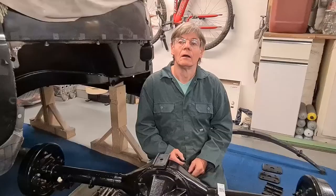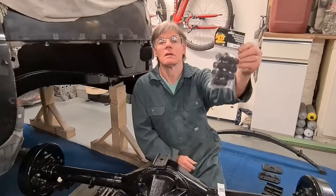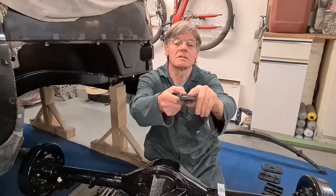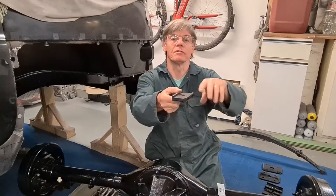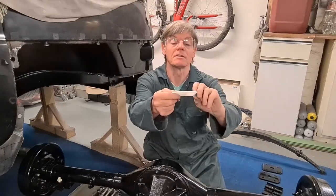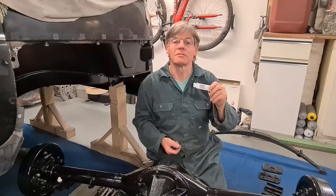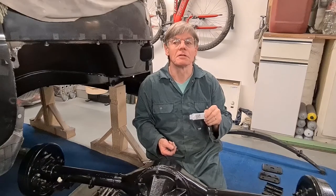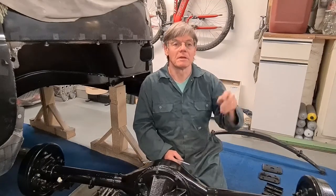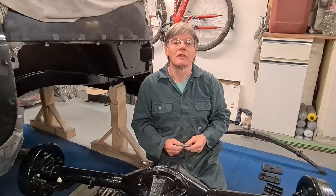When you do the nut up it tightens the pin onto the bracket, and there's nothing on this side to stop it going in and out. I've got all the parts together now and cleaned out all the threads on the bolts, ready to go. I've got these Superflex poly bushes and they came with rubber insulators that insulate the leaf spring from the axle, and one bag came with a sachet of silicone grease. I've read on Facebook that you need to use a lot of this grease to stop the bushes squeaking in the future, so I don't think there's enough in the sachet. But it's not a problem because I've got a tub of silicone grease and a bottle of silicone gel that I used to use on a treadmill.